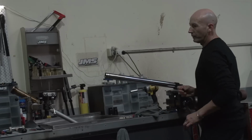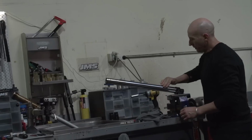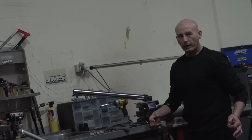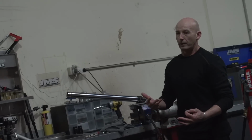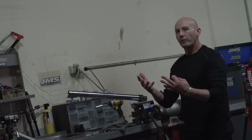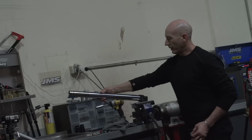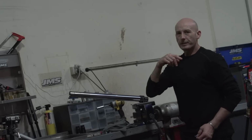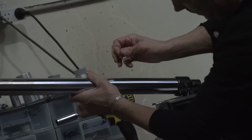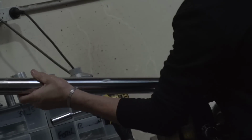Yeah, so far so good. Put new seals, bushes, but I found in this one, which was the worst one that was leaking, a lot of people don't realise, when you've got your fork covers on the front of your forks, what happens sometimes as the wheel goes around, it picks up little stones, but they throw them off into the fork. They throw on the back side of the legs. So you'll get a stone that just ricochets everywhere, even off the frame or the engine. So if you can get to it before it rips the seal, you can get the sharp edge off, it's all good.